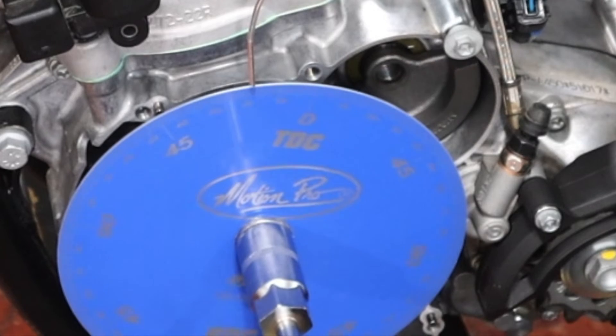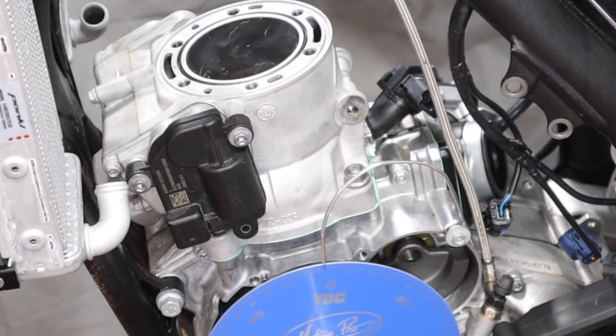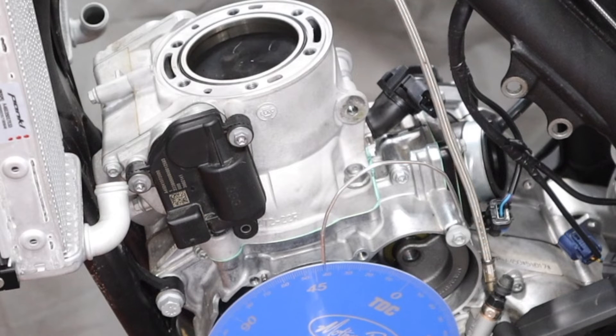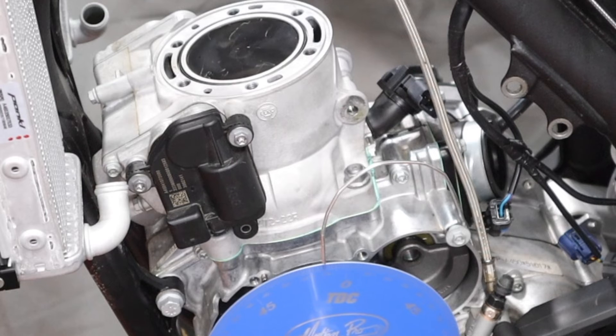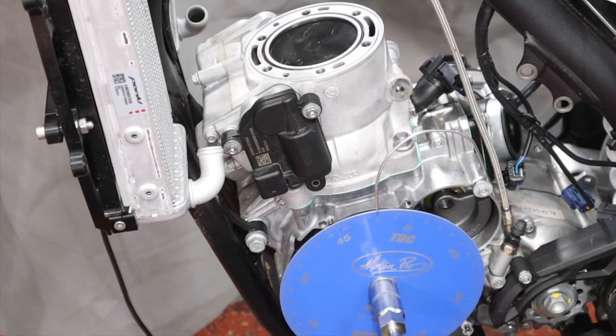All these are in degrees, and it's 180 degrees from bottom dead center to top dead center. When your piston's at the top, if you ever looked at the ignition timing numbers, that would occur before the piston gets to the top. So let's say here's 10 degrees before top dead center — more realistically, like 20 degrees before top dead center. Your spark plug's going to fire about now. The whole purpose of that is to give the fuel enough time to completely explode and make its power just after the piston passes top dead center and is on its way down. It has to fire before top dead center because of what we call lag time — everything takes time to happen, and the faster the engine is going, the sooner it needs to ignite.